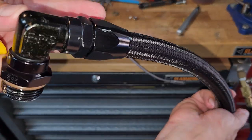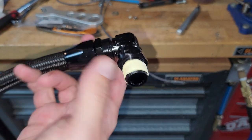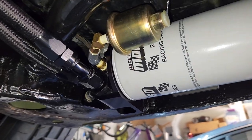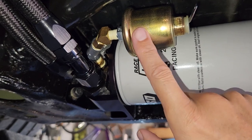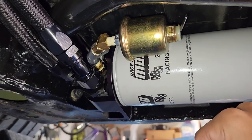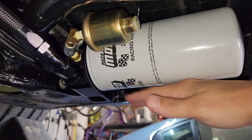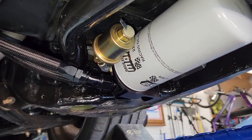All set to put in the car. I have a new O-ring for the oil filter side and yellow PTFE tape — made for petroleum products so the white stuff doesn't deteriorate. I'll only put about two threads of tape on and won't fully tighten until the other hose is finalized. It looks spectacular with some 45-degree fittings added and nicely tucked under the body. This is super sturdy and it's already giving me ideas for another solid modeling project — like a cover plate to prevent rock damage to the oil filter.